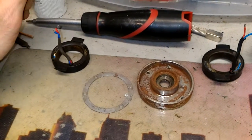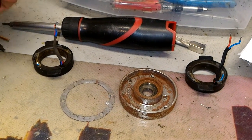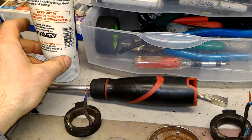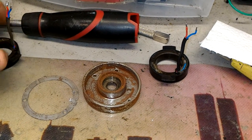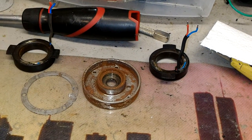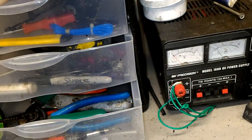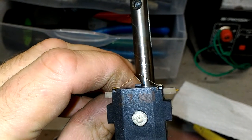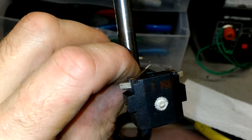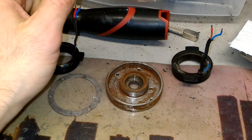Now the unit is completely cleaned inside — very nice. Lubricated gears are clean and lubricated. I put some white lithium grease on the shafts. I was really scared about the potentiometer, but the potentiometer was spotless — that's a really good thing. It was clean, doesn't seem like it was overheated, and there's lots of life left on the little brushes, the sliders. I would say about half life left on yours. I did look inside the potentiometer and it is not cracked. So that's another good thing — the unit is pretty good.